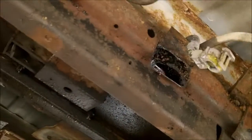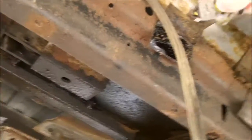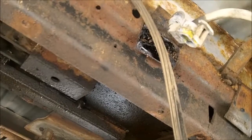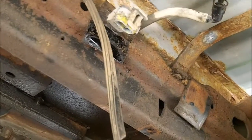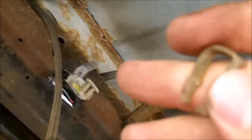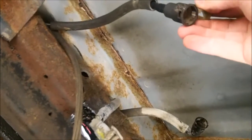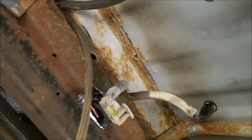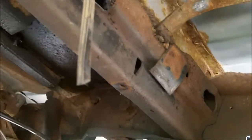Here are the lines you get. This is the vent tube — this just ends at a dead end on the frame rail where it vents out. Got your sending unit plug for the fuel gauge, your return line, and I believe this is the pickup line. To disconnect these you don't need any special tool. You have these clips that go through them — they go in through one of the holes. To pull the fuel line out you just pop these out with a screwdriver and it just comes off.